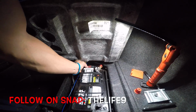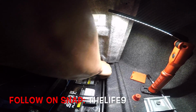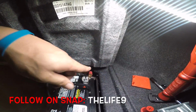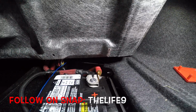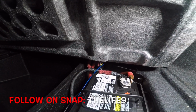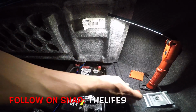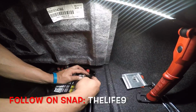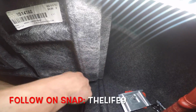So, you can go in the garage way. So you connect that like that. Push it all the way down there. Obviously, guys, if you don't have subs, you're not gonna have this positive cable here. That's for my amp. And this blue wire, you won't have this either. That's for my switch for my remote wire to the amp, so I can cut it on and off. But you see, I just touch metal. If I had the negative cable connected, it'll start sparking.